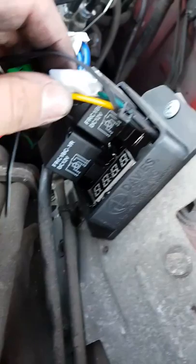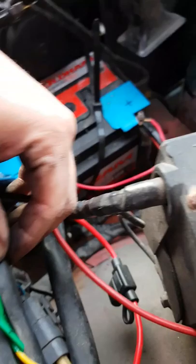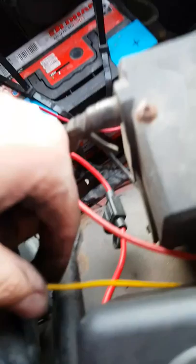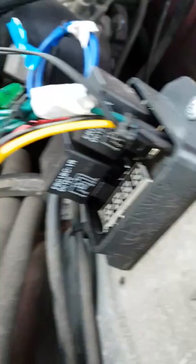So you've got your controller here. This is your positive main lead, which wires directly into your battery. Your black lead — this little one here — goes directly to the earth of the car. Your yellow one is your switch controller, or your ignition. What I did is I used those little fast-fit tap connectors — I put one straight onto the lights wire, which is yellow on this car. Obviously a 90s model. Yellow means ignition, which means yellow wires here, or obviously ignition — especially when it's lights. This thing won't come on until the key is turned on in the ignition. Now this is a dual controller so it operates two fans, and it also has an AC cable as well, but this car doesn't have any of that fancy stuff, so I just taped up the ends.